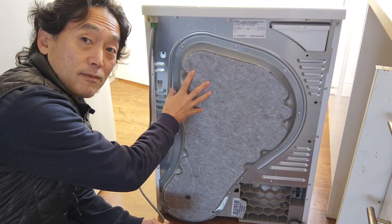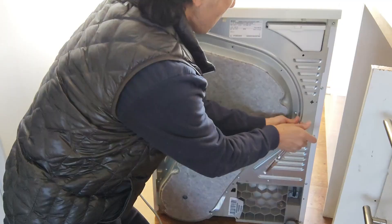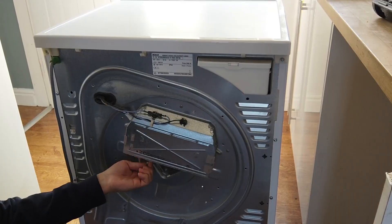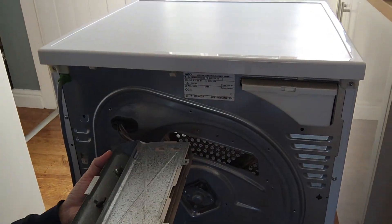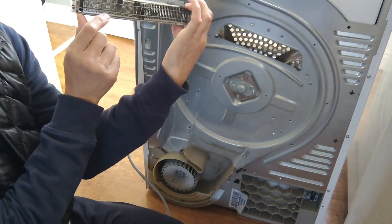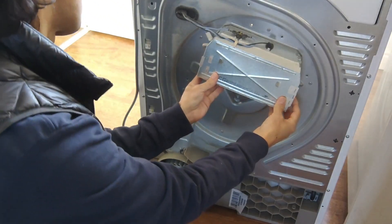So in order to mitigate that condition, I have one idea I want to do. The back part of the panel to remove, and the duct as well. Check the heat unit — the temperature sensor and limiter sensor. Give a little bit of a wipe. Looks all okay, so put everything back.